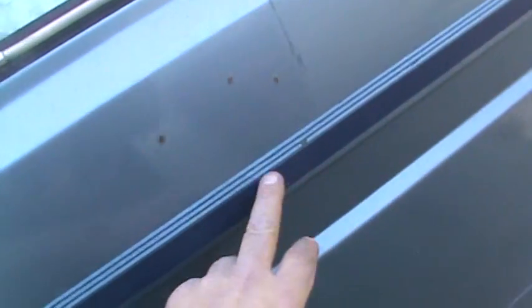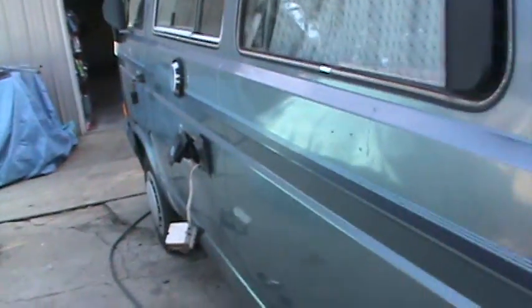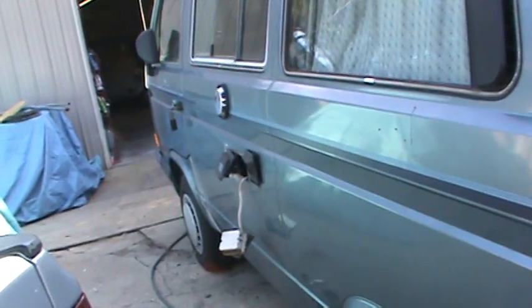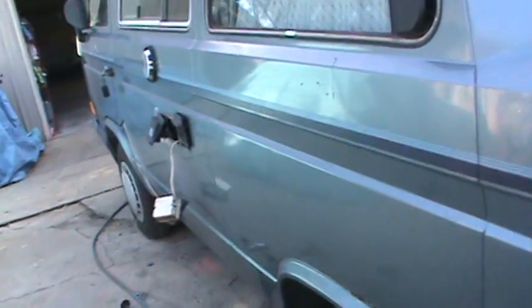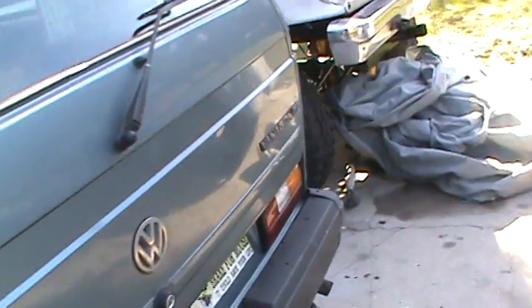Went ahead and took the stripes off because the stripes are sort of rough looking. They have some pieces missing here and there. They're peeling up, so I thought it'd be better just to start fresh, and I didn't want to clear up to that or anything crazy like that. So we'll just be clearing the whole side, throwing some color down around our repair areas, blending it out and clearing both sides of this.